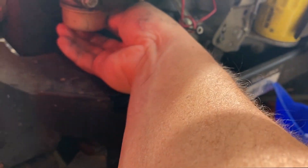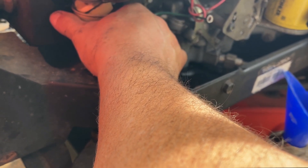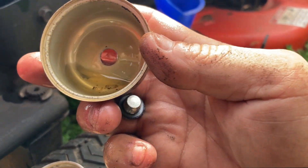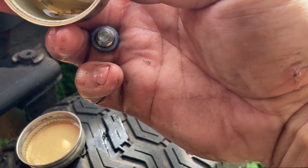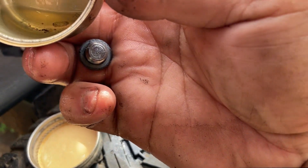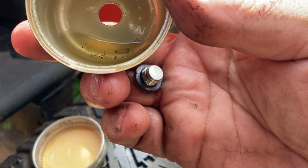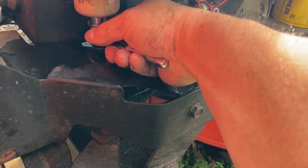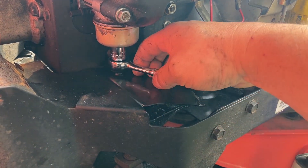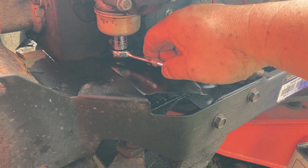There's fuel in it, so that's definitely a good reason to take this off. Oh, there's the gasket. You see all that junk? See all those floaties in there? The fuel's not bad — I don't see any water in it, but I see a bunch of dirt. So it's probably a good thing that we're draining it. It'll be fresh for the next year. We got the bowl back on — just use our 13 millimeter, tighten it back up. It didn't seem that dirty, but if it doesn't start in the spring, we'll clean out the jets. Not too tight, just tight enough.